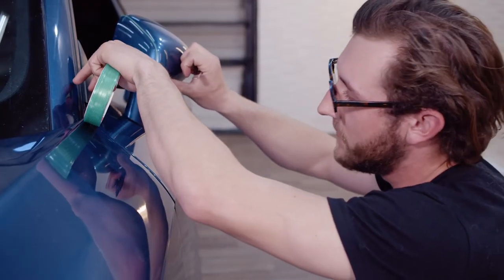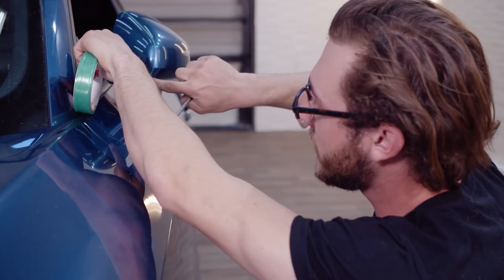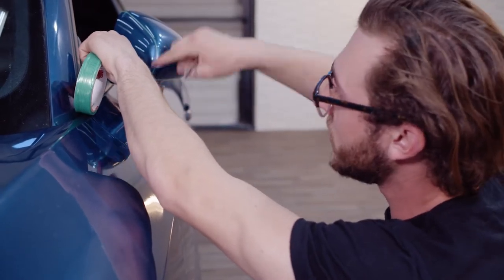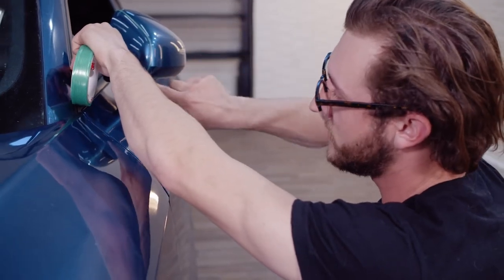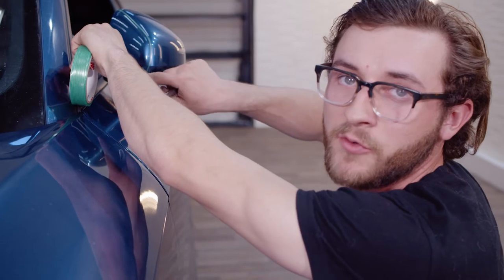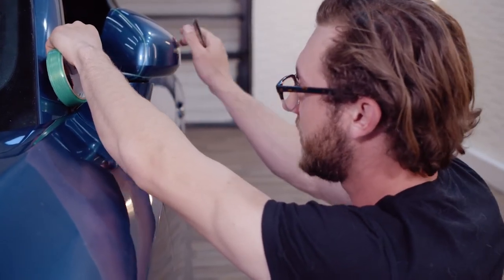And when you're placing the knifeless tape, it's really important to make sure you remember which order you place the tape as it overlaps. Because if you put this one under the one I'm doing right now, and you pull the string, it's just gonna run into this one and it's not gonna work. So just make sure to remember where you're putting which strand of the tape.